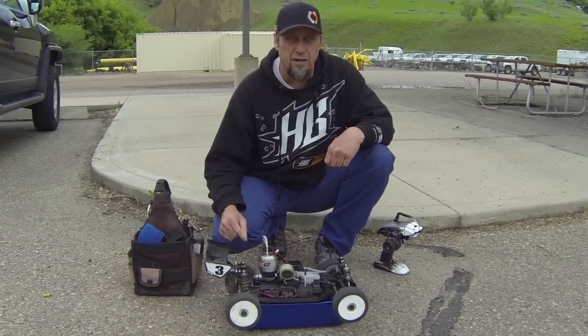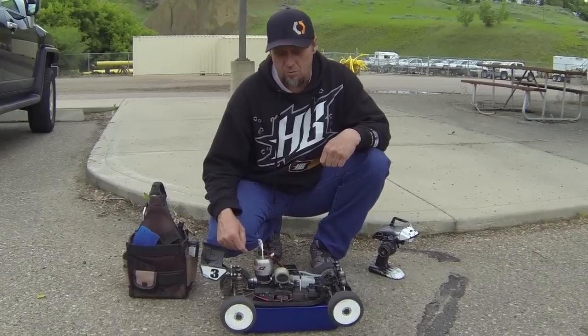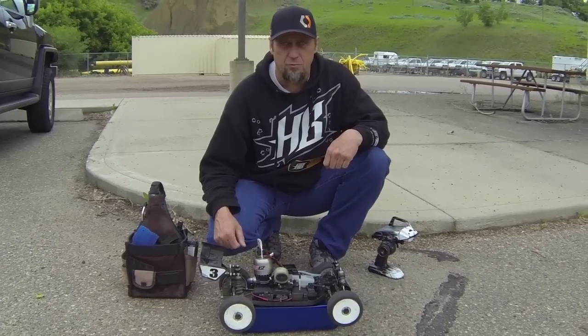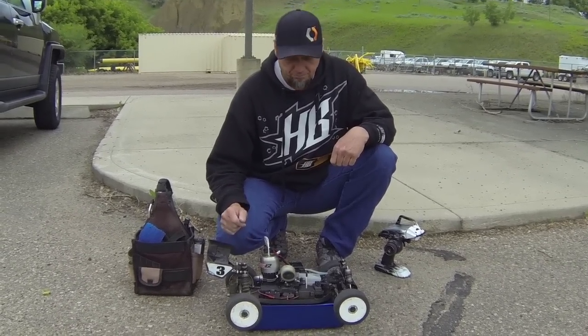I recommend preheating the engine every time before you start it up till tank 10. We're doing tank 5 through 10, so 6 tanks we'll do in this parking lot. Make sure the head heater gets the engine really hot before starting it. I'll prime it again, start it up.